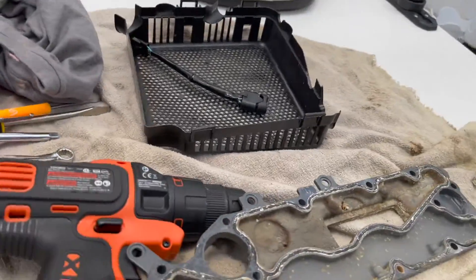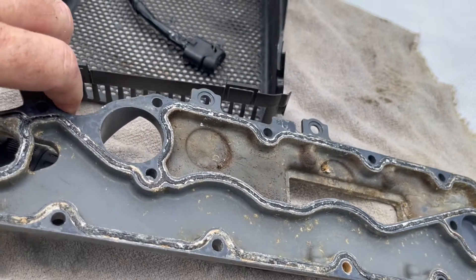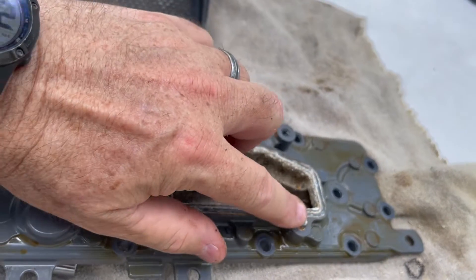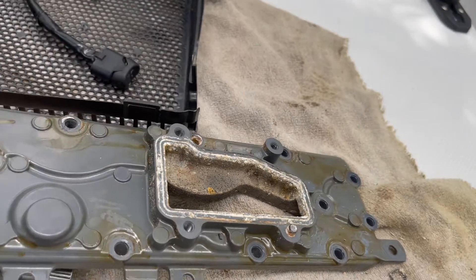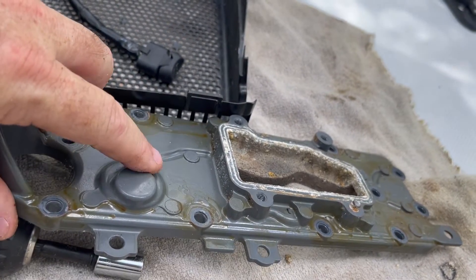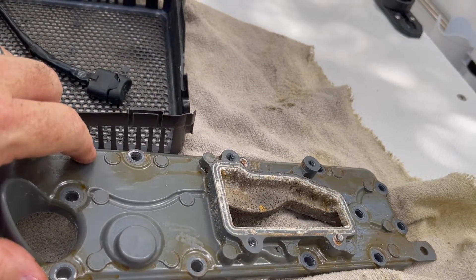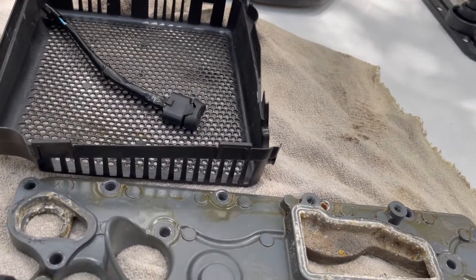Here's the cover — I've already got the gasket on my bench and I'll be cleaning the head and water jacket cover as well as the water passages over there on the motor. But here's where the bolt broke off on the rectifier. Plan A: I'm going to try to pull that bolt out. Plan B: I can order a new water jacket cover. This water jacket cover is $125, which might be cheaper than having somebody do it for me. We'll see if I can get it out.